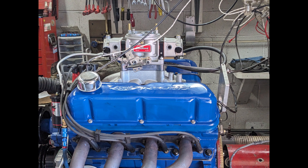I was pretty impressed with the Edelbrock and the performance it made out of the box. I only made one jet change and was surprised — maybe not so surprised — that it did so much better, actually putting me over 500 horsepower where I probably wouldn't have reached 500 without that carburetor. Hope you liked this video, thanks for watching.